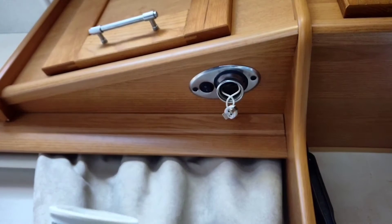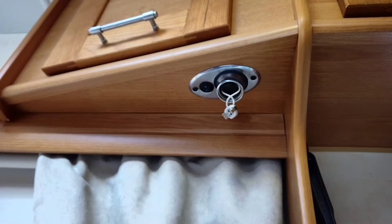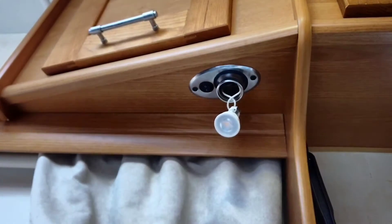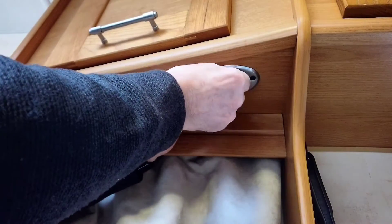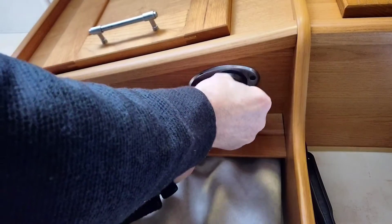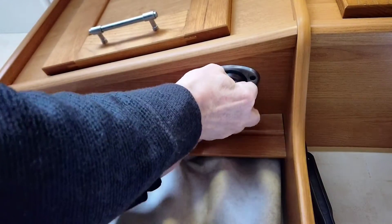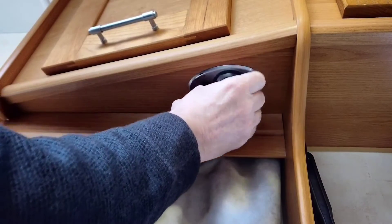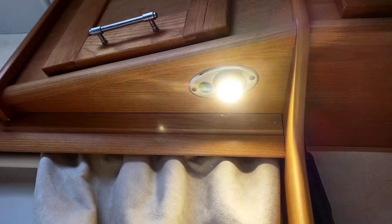You probably can't get the focus in to be honest, but I'm doing what I can. Right, so here's how simple it is — you just take your bulb and clip it in, get the retaining clip and carefully install it up, then put the retaining clip in which can be a bit fiddly if your hands are cold. It would help if you put the thing the right way around — and there you go, look at that! How simple was that? Bulb in and we have light.